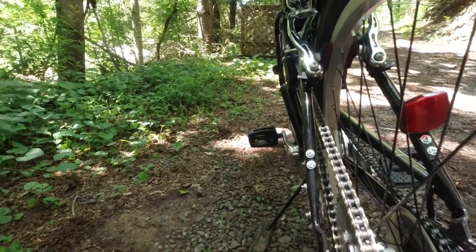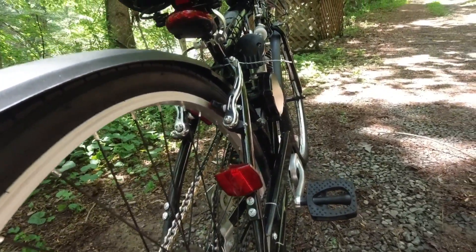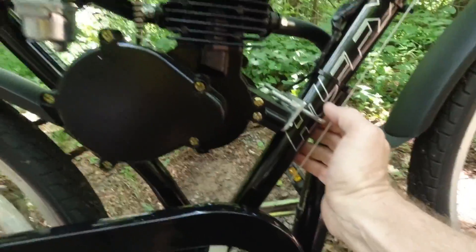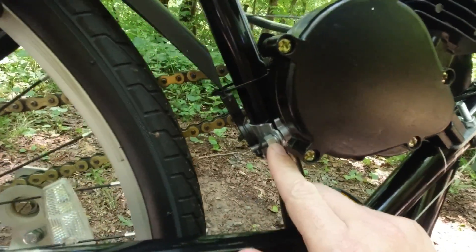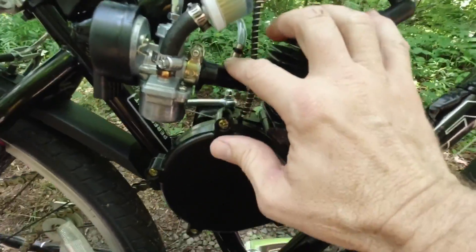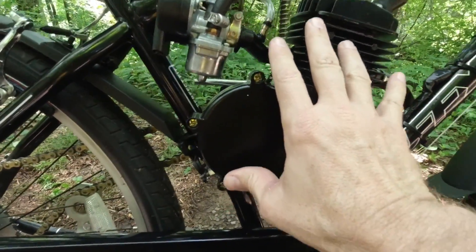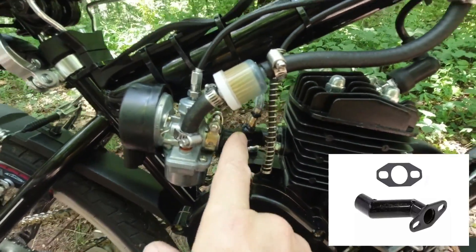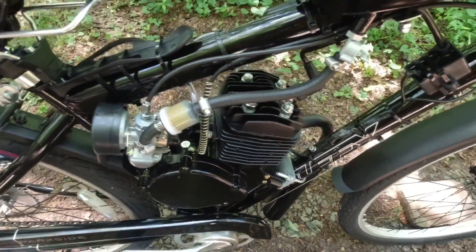These are all things that just help as you put it together. Once you get the sprocket on, the rest of the process is pretty straightforward. I watched the installation videos over and over, and sure enough it was simple — mounting the engine is easy. You have mounting joints here and here, and you don't want to tighten everything down until you get the chain in. On my bike, I had to rotate the engine up and buy a little offset intake adapter, which I'll link below — it just gives a little extra room and doesn't hit my knee or anything.